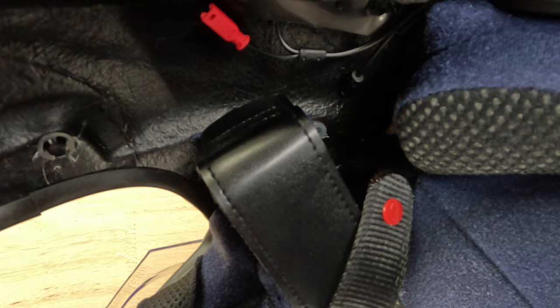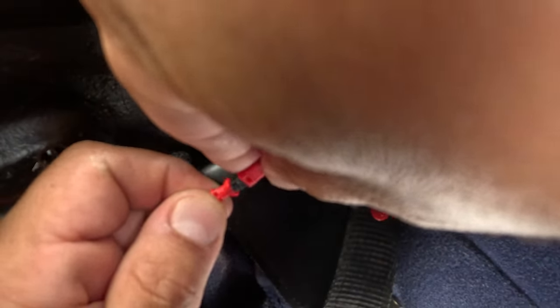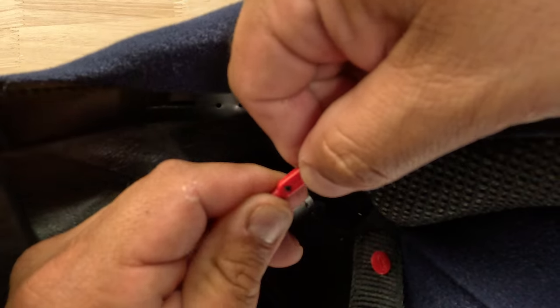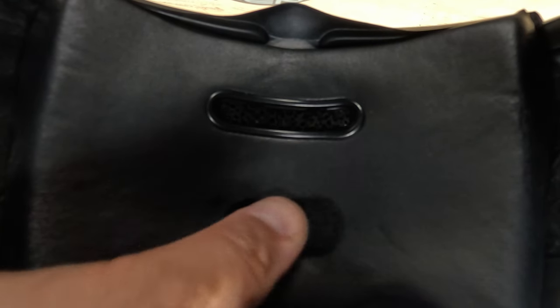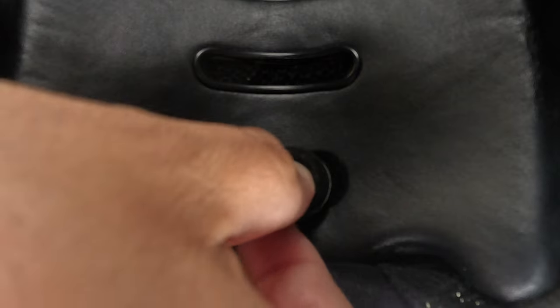So the next thing we're going to do is go ahead and install our microphone. Remember earlier in the video I told you there were two red tags — that's for the microphone. There's a triangle on the connector and a triangle on the unit, and that's how it goes in. Go ahead and put the hook and loop for the microphone. We're inside the actual helmet — this is the front, and right here is where you're getting air. You don't want to hook the microphone too close to there in case you get wind noise. I'd recommend putting it a little further under, about right here. Our unit does have noise cancellation, but this is a little extra precaution. Go ahead and put it there, and the microphone is going to be Velcro on this side — it's the hook and loop setup.